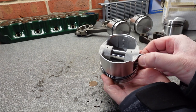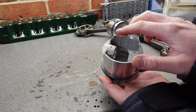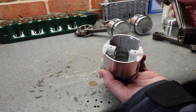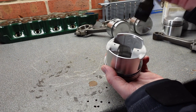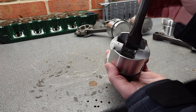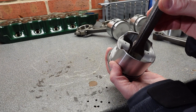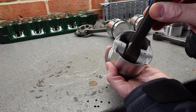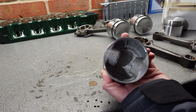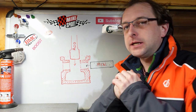I'm going to gently pull out the pin from the pistons. These are actually a balanced set — factory balanced and sized, so they're all the same weight, as are my rods. It's not just a matter of heating the end and whacking it through. What we need to do is offset the pin slightly as we push it through, because there is a bit of slap — approximately 2mm of gap down one side. In classic style, let's turn to the whiteboard.